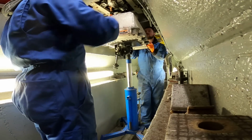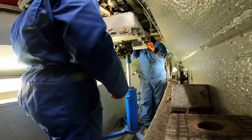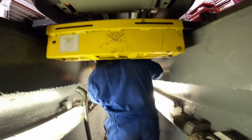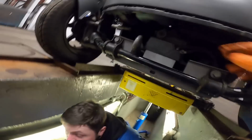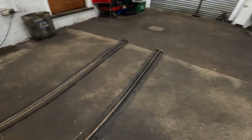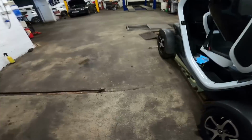Well, yeah, I'll just connect the 12-volt battery up. It's enough to power it. Do you want me to squash past? So if you hold the 12-volt battery terminal on and crush under here, and then I'll... How stable is it going to be on the jack? Yeah, it'll be alright. Ain't going nowhere. Nobody sneeze. Hold that on there. And that should be enough for me to turn the ignition on. It's probably going to have a meltdown so it won't see the traction battery. But it'll be enough for me to get the handbrake off.